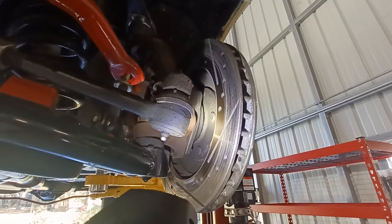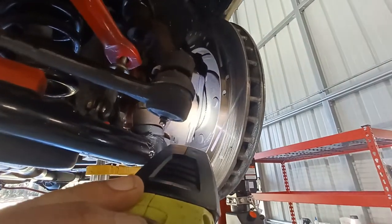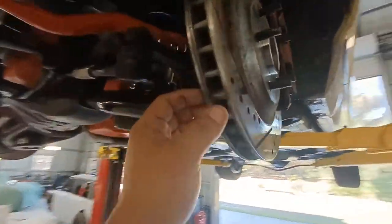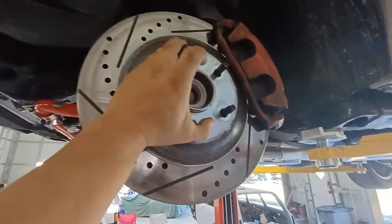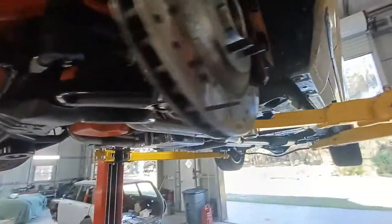The entire hub assembly — which doesn't even have 300 miles on it — is falling apart completely. I started feeling a weird sound from my brakes, and when I looked at it, it was grinding the inside of the brakes. The whole hub was moving around. It has a lot of play — more than it ever should — like it was just about to fall out completely. You can see it better here; I'm going to move it around so you can see the inside. Look at that — 300 miles on this thing.